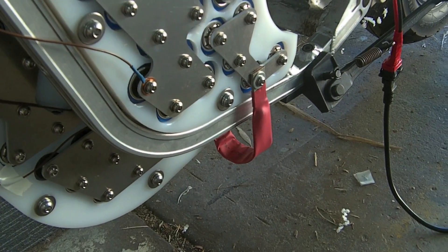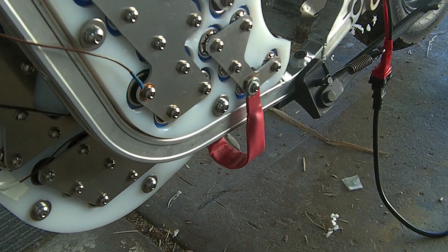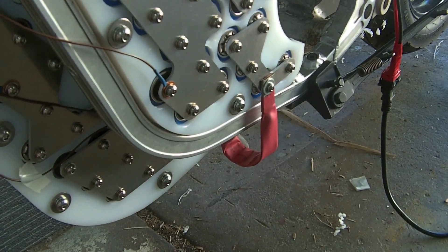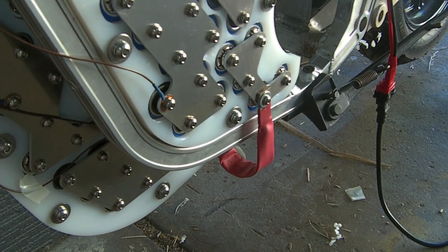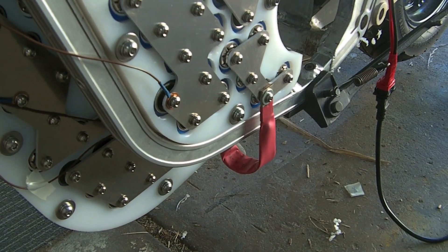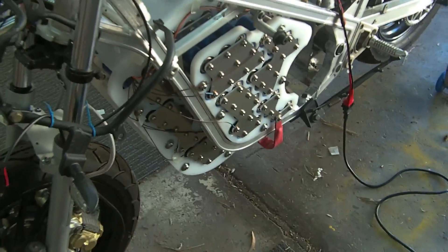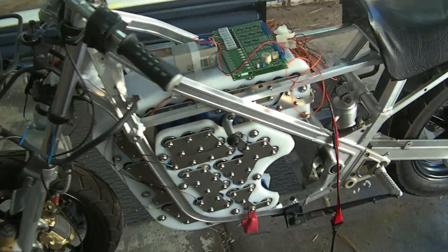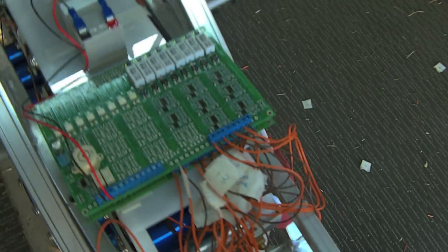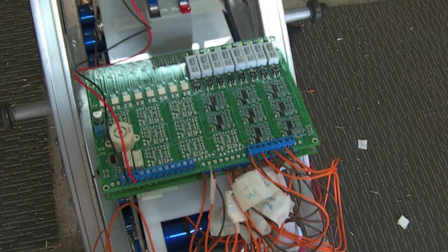You can see the inner and outer packs at the moment are joined together by some earth strapping — it's good for about 120-140 amps, however not ideal for the permanent situation. I'll be running loops of at least two AWG wire to join those packs together. I have temporarily placed the BMS system on the top of the pack and temporarily wired them in, so that rats nest of wires will be tidied up with a proper plug and box arrangement into the BMS.